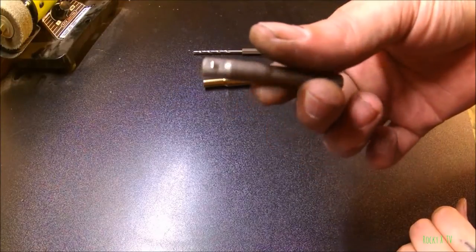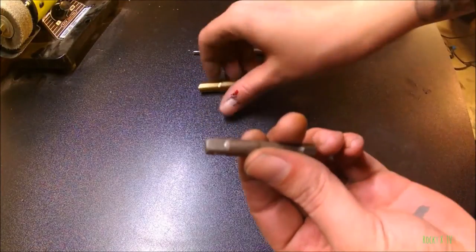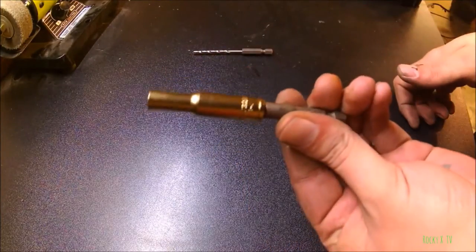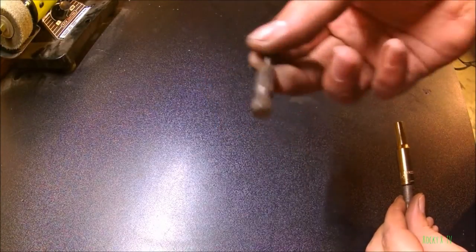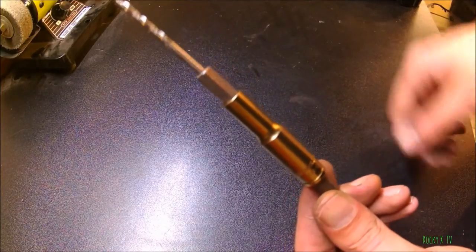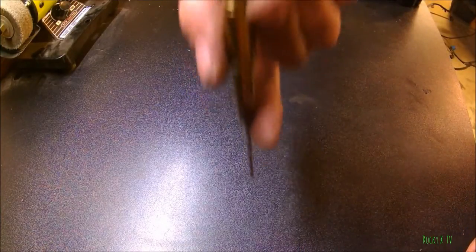Grabbed a little quarter inch socket driver, I guess you would call, that I could put into the drill. I took a quarter inch socket, and luckily I had these drill bits around that have the hex shaft on them, which are actually a quarter inch. I'm going to tape it together so I don't lose anything down in there, and this will actually be long enough to drill straight down and make a small pilot hole.